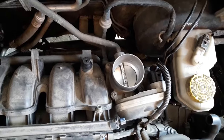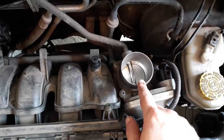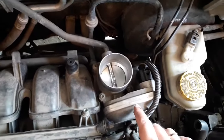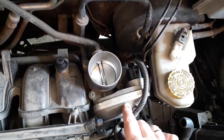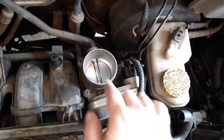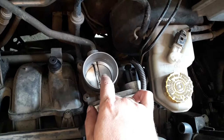For those of you who don't know what a throttle body is — it is essentially a valve that regulates the airflow into the air intake manifold. On it there is an electric motor which is activated by pressing the gas pedal, so when you press the gas pedal the electric motor opens the butterfly valve.